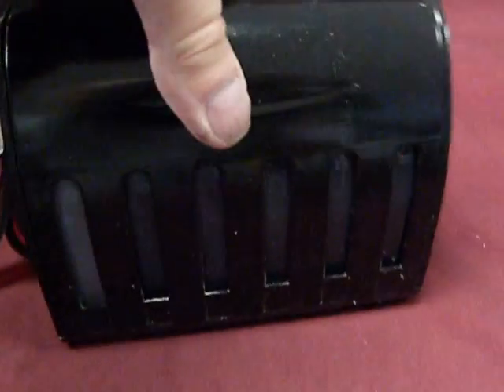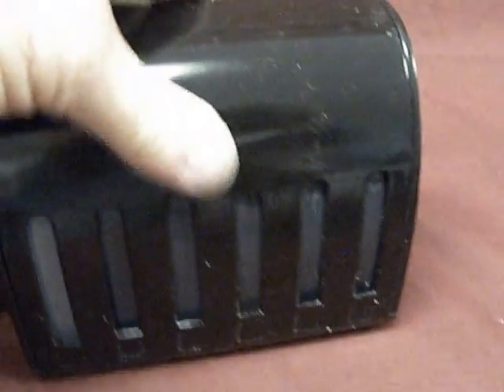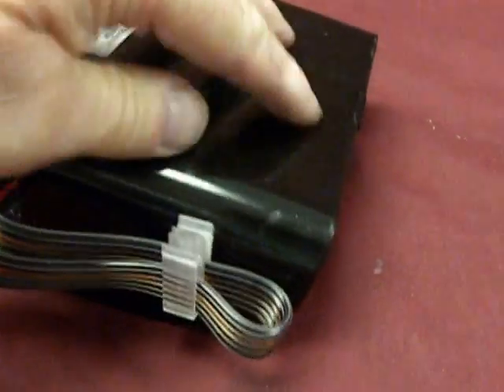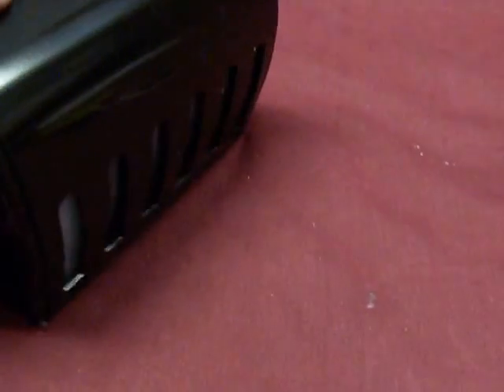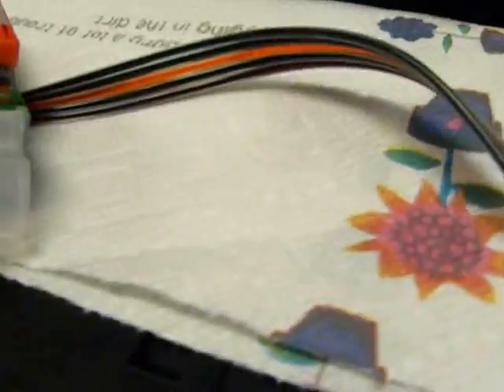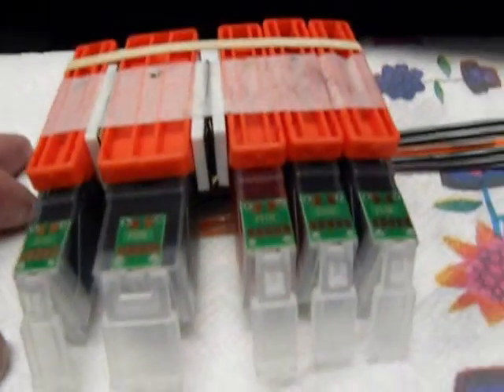I'm going to put some paper towels down. Make sure the plugs are in the tank — don't open up any plugs. Then I'm going to rock it. This is to remove any ink that got into that isobaric chamber when we shipped it, or if you pull out both plugs, sometimes you have to do this. Just go back and forth a couple times. Now you can lay the cartridges face down on paper towel.